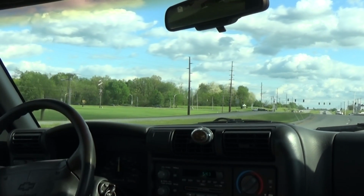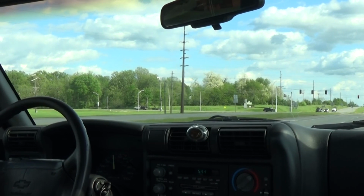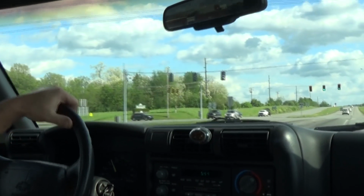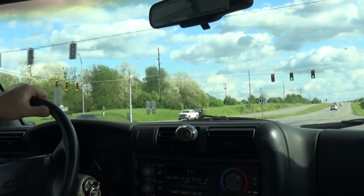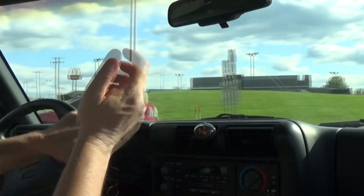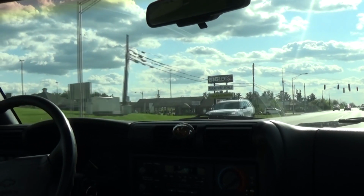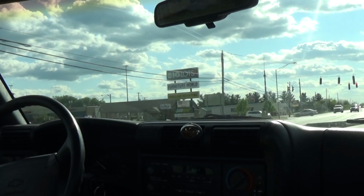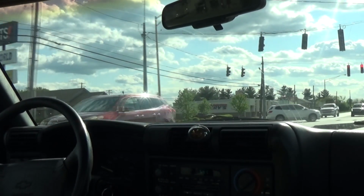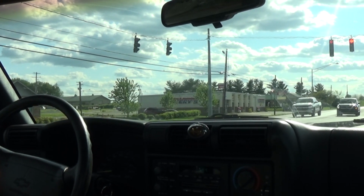And I don't know if the check engine light is gonna come back on, the monitors are not done, most likely due to an ignition misfire. Who knows for how long that was going on with this truck, even before maybe the injector was a problem. So most likely the catalytic converter is shot, but you know, what do you do? I just have to tell the people, you know what, we just have to wait for the monitors to be done, and if the check engine light comes back on, don't be surprised, we'll have to check it again, you know, EVAP or whatever, EGR and all kinds of stuff. Nothing's been done,